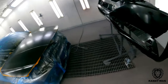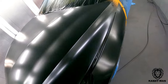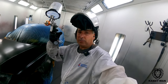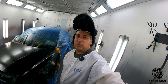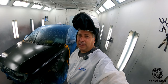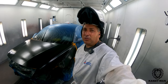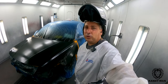Alright guys, we're ready for clear coat. The base is all dried on it, it's flashed off. We're using the LPH and I'm still dialing this one in. We're on back order for our slow hardener with Sherwin Williams right now, so we're using the UH80 with the US6 reducer. I like that US6 reducer. I actually have some UH90 left and I've been using it with that — it lays it down really nice. So what I'm putting on right now is the UH90 with the CC200 and the US6.